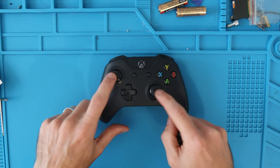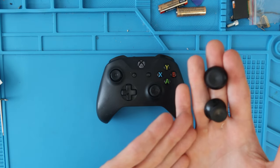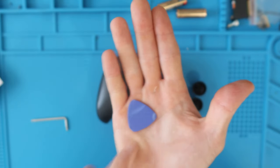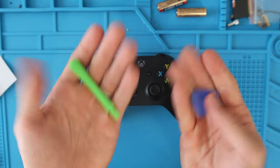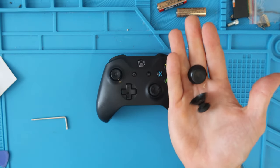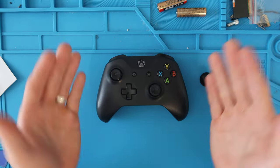You're going to need your broken Xbox remote, replacement thumbsticks — toggles, joysticks, whatever you call them — and a T8 security bit tool to get the screws off. You're also going to need a prying tool like a guitar pick or a plastic spudger. Links to the parts and tools are in the description. I think you can get everything for less than $11, which gives you six replacement joysticks and the tools — way less than buying a new controller.